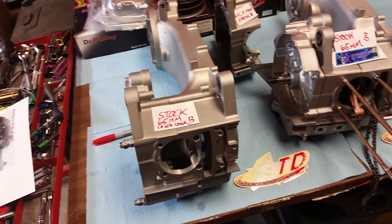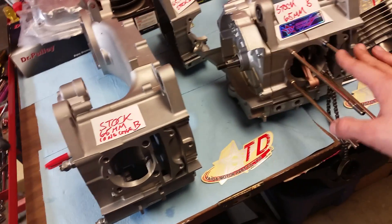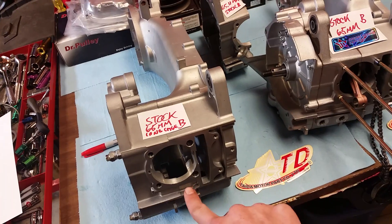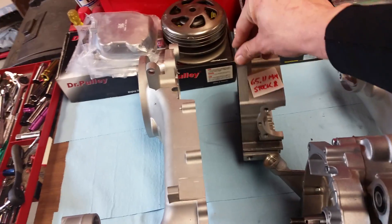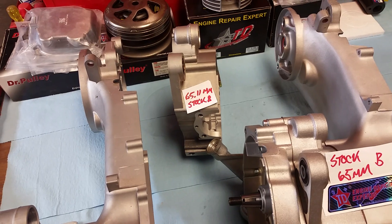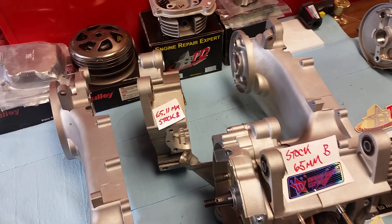This is the kind of engine you'd get from other companies that sell the 180cc power kit. This is also a B block, however this can only be bored out to 66.5 millimeters — it's a long case. It comes stock at 65 millimeters, then they bore it out to 66.5 to accommodate the 180. Stock size is 61 millimeters and it's a 169cc. Over here you see the motor listed all over the internet as the 161 QMK — it's got a built-in oil cooler and is also listed as the GY6 200. It is not a 200 — it's a 169.